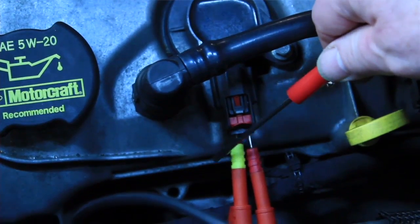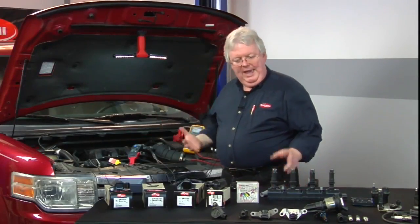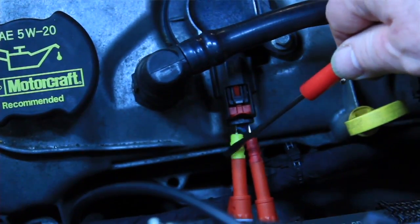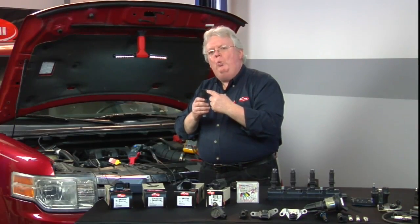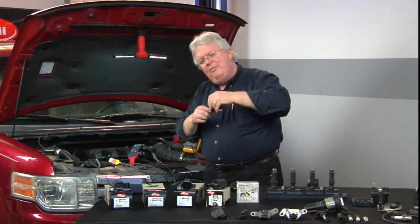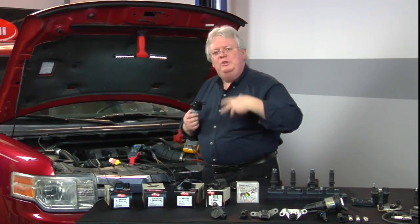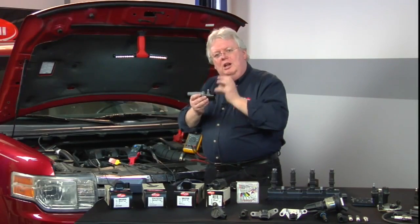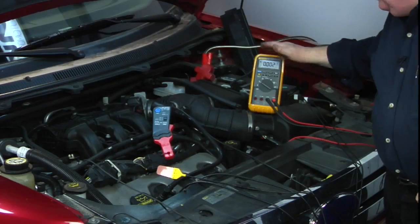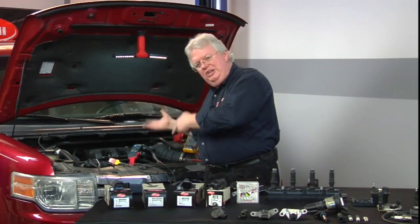What we're going to do here is look at simple power to the two-wire coil-on-plug on key-up — two different ways: once with the meter, once with the scope. I'm using the back probe of the two connections. Since we have a primary winding — which we're hooked into right here — power from the ignition fuse goes to one side of the winding, and a ground, when the PCM applies it, goes to the other side of the winding when we want the primary winding to saturate and build up a magnetic field. We then collapse it to create self-inductance, which causes the mutual inductance of the much longer, larger secondary winding to make the spark. So what will we see between chassis ground with the meter? I've got my black lead on ground and the red wire going to the ignition coil.